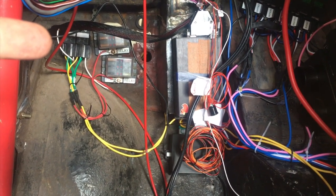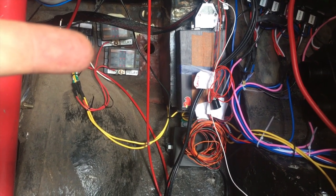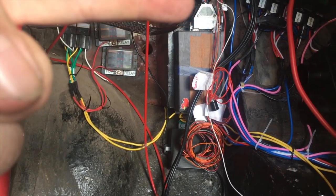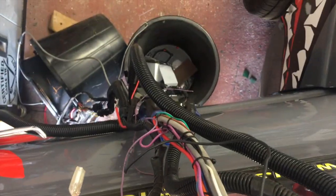Here I've got the two main relays for the main relay board and the fuel pump relay for the fuel pump relay board, and obviously the ECU. Got the plug-in, and then these trailing wires here are all trigger wires, and then this part of the mess is all this other stuff. As you can probably tell from all of that wiring, there's still loads of stuff I want to take out before the loom is fully installed.